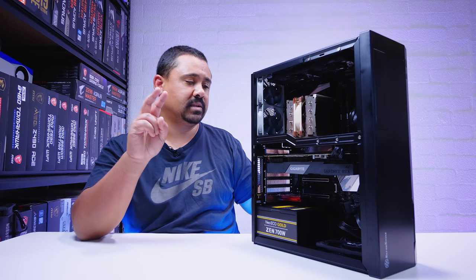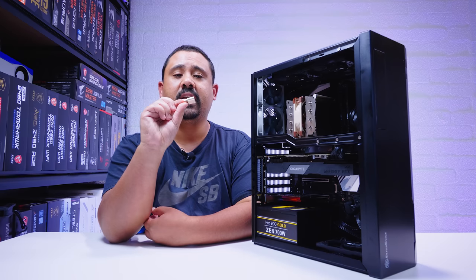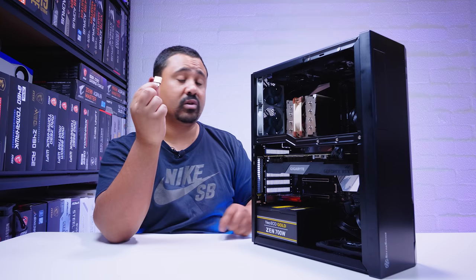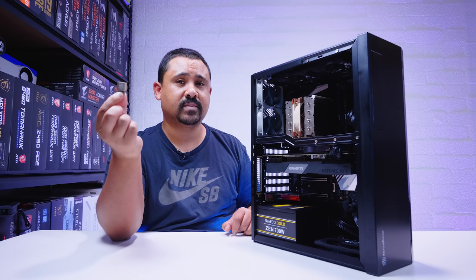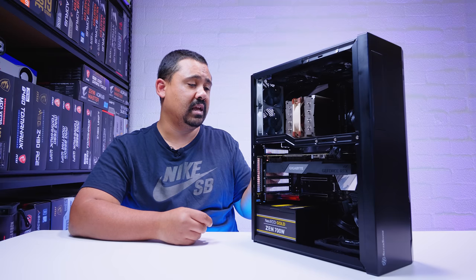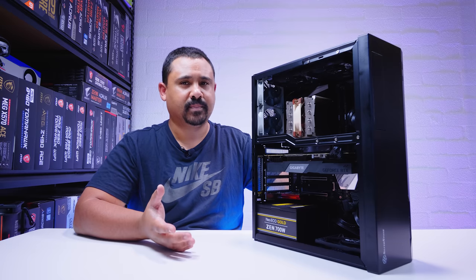You'll need two things. The first thing you'll need is a dummy HDMI adapter. This is a 4K one. So this tricks the GPU into thinking it's got a 4K monitor plugged into it. The reason for this is when you log into Parsec and there's no physical display output, Parsec won't display anything, which kind of leads into the next thing that you need. You need to have a pointing device plugged in. What does that mean? You need to have a mouse plugged in.